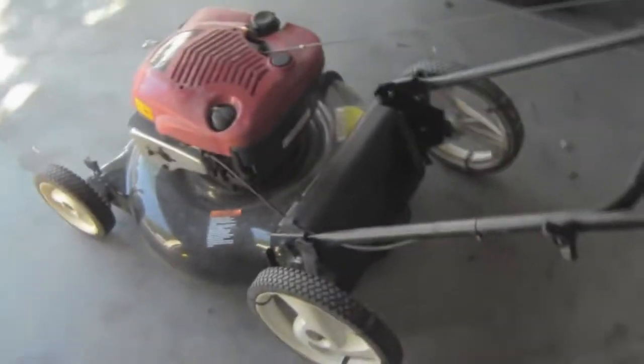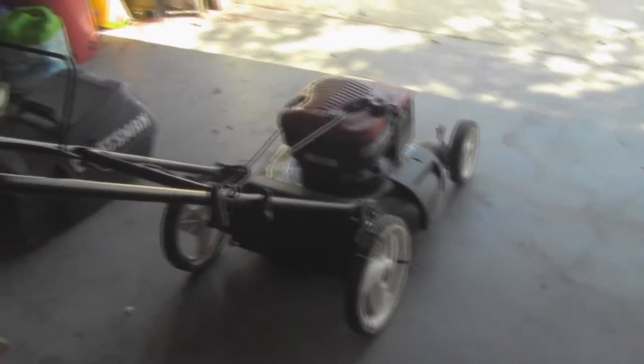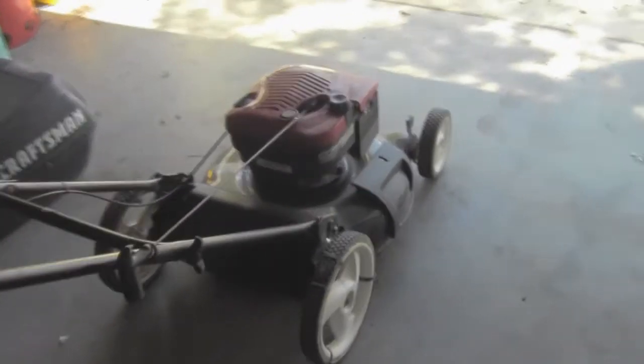On the second startup it belched out a little bit of black smoke — it's running a little rich when it first starts up. It's not enough to flood it or anything, but it's enough for me to want to pull the carburetor off and give it a good thorough cleaning. These ready-start mowers can just become very, very temperamental, so oftentimes it's best to clean them out every so often even if they are running fine. The grass bag is largely in really good shape — most of the time when I pick these up they're always ripped, but really it's in good condition.